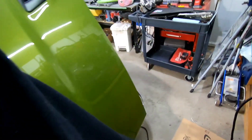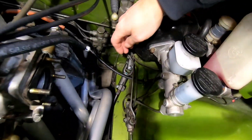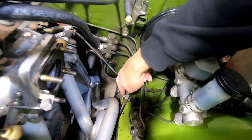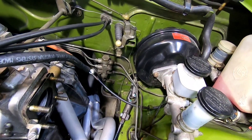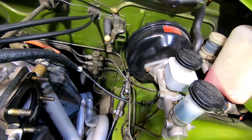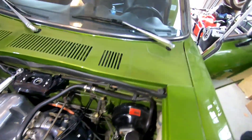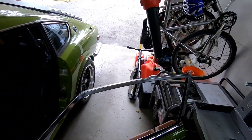The kit includes everything from this point back towards the driver, and it removes the donut — I had a urethane unit before. It uses all new u-joints, so it should give a very tight feel afterwards: easy effort with a tight steering feel.